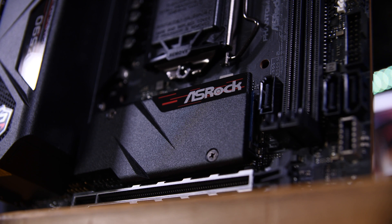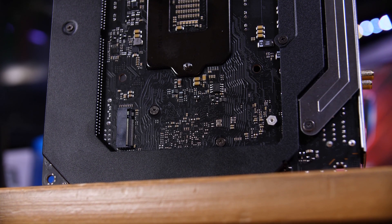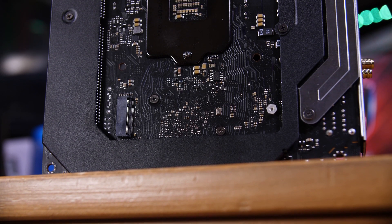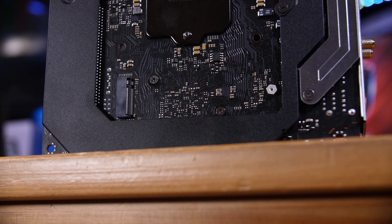The last thing we'll want to do with the board before moving to the case is install our main storage drive. I'm using a one-terabyte M.2 SSD. One really cool thing about this board is that if you're using an 11th-gen Intel CPU, the front M.2 slot offers full PCIe Gen 4 support, so you can run a fast Gen 4 SSD as your main OS boot drive. There's also a second M.2 slot on the back of the board that supports up to PCIe Gen 3, meaning you could have a smaller, fast Gen 4 drive up front and a larger Gen 3 drive in the back for less speed-sensitive games.